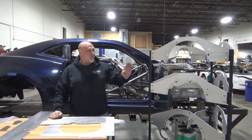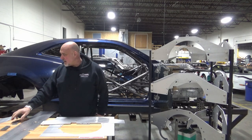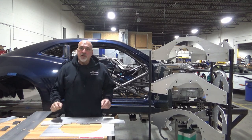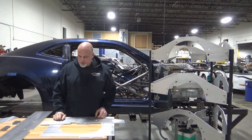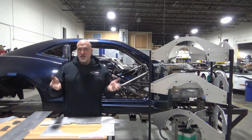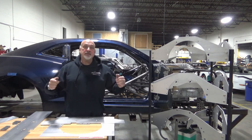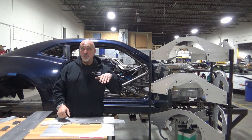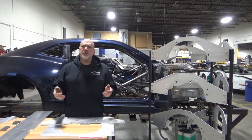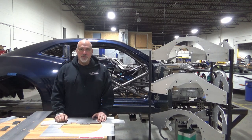We have everything in our motor and mid plate kits when you buy them as a kit. They come with all the tabs and a bag of grade eight hardware, and they're a pretty easy install. Same with the mid plate — they come with the tabs and you'll get your crank center line optimized by welding the tabs to the bottom of the frame rail, then setting your motor plate on top of it. Then all you have to do is adjust for your drive line angles, usually somewhere between two and four degrees down, depending on your tire size and the build that you're doing.